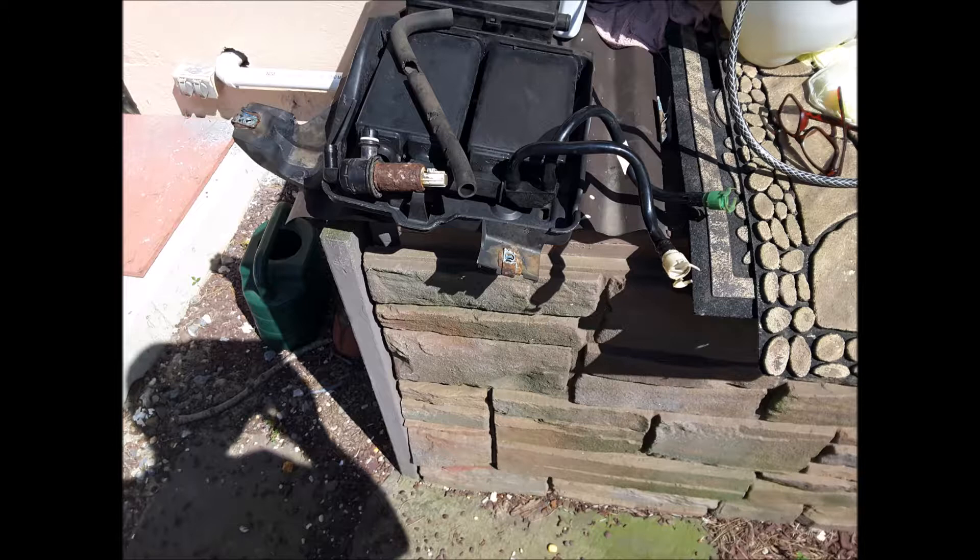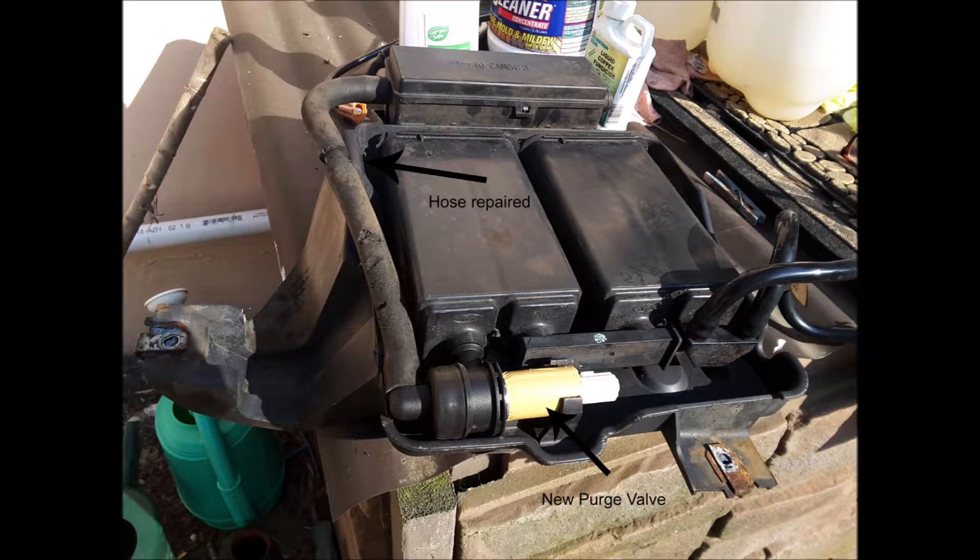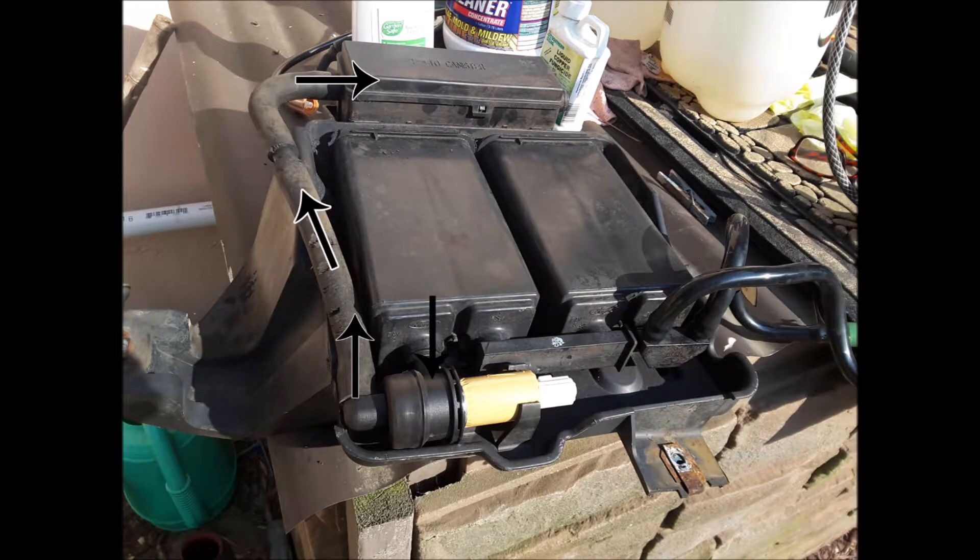Cheap cars means cheaper vent valves manufactured identical to the more expensive ones, so why waste your money? It's all in the marketing. Since the chewed vent tubing had a bend in it, I cut out the bad section and installed a smaller internal extension. It's just a vent. I could have left it off — after all, this video was made in 2019, so the car is 19 years old.